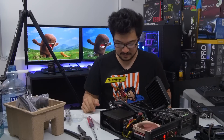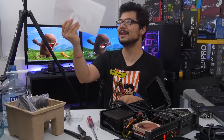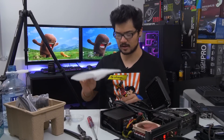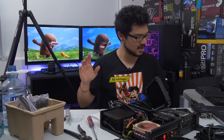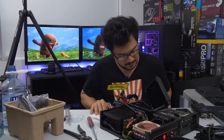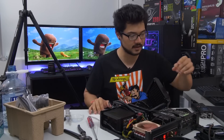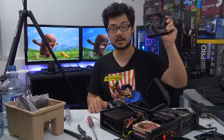It's been about 10 to 15 minutes, and it looks like there is not a single drop of any kind of fluid on this paper towel here. So our leak test, at least for now, has tentatively passed, and now we can go ahead and move on to installing this thing properly. As far as fan choice, I don't know if I can get away with a standard 25mm fan, but I'm going to try.